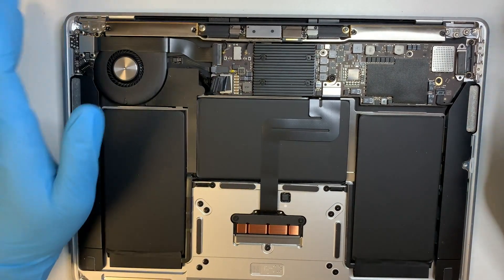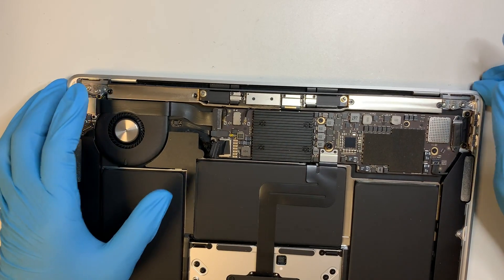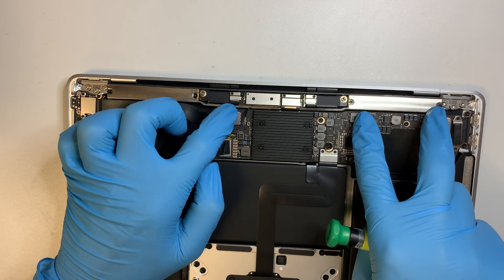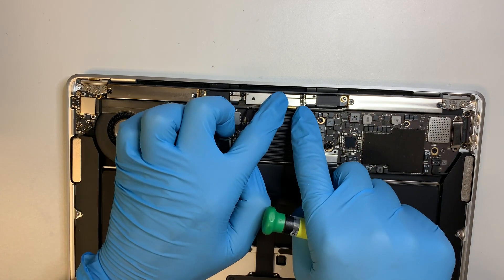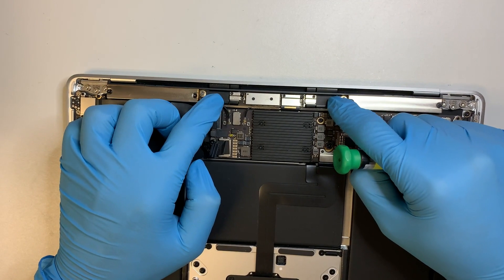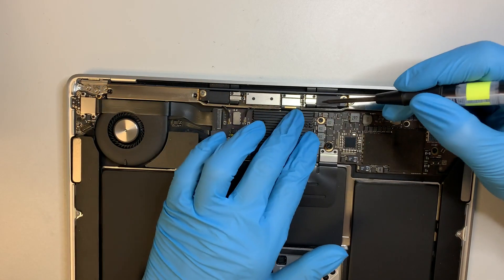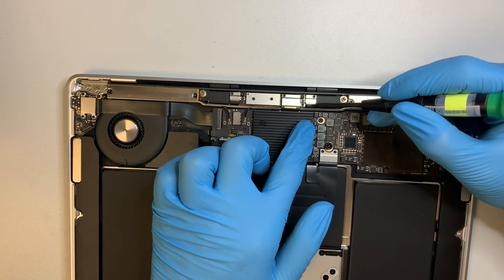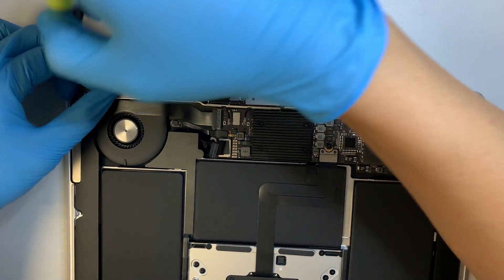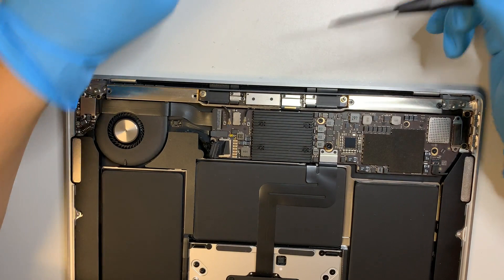Now that the Wi-Fi cable is taken care of, the next thing I'll be doing is removing all the screws here on top. There are two screws on both sides, two screws with a bracket holding one flex cable, two screws and a bracket holding the second flex cable. There are also bigger screws holding the LCD controller, and two more screws with a bracket holding another flex cable. Make sure you have the screws aligned and arranged properly because the screws are not the same sizes — don't mix and match them.